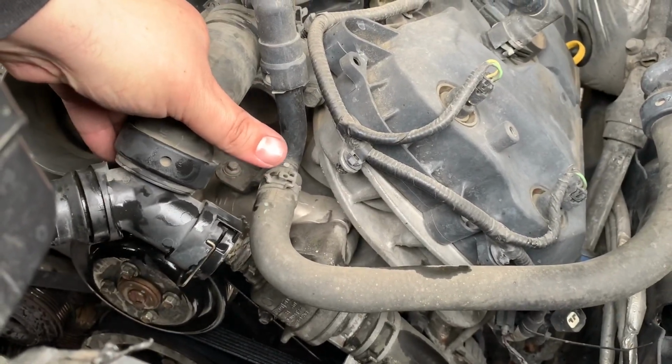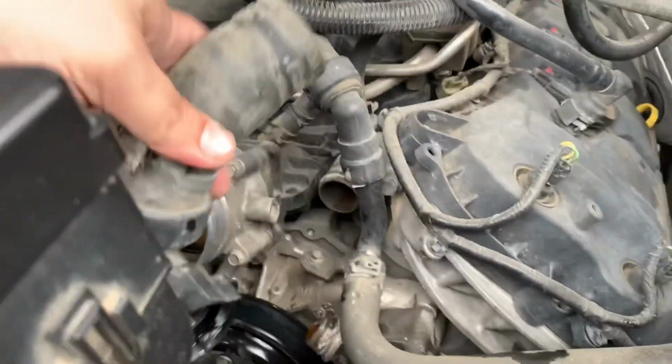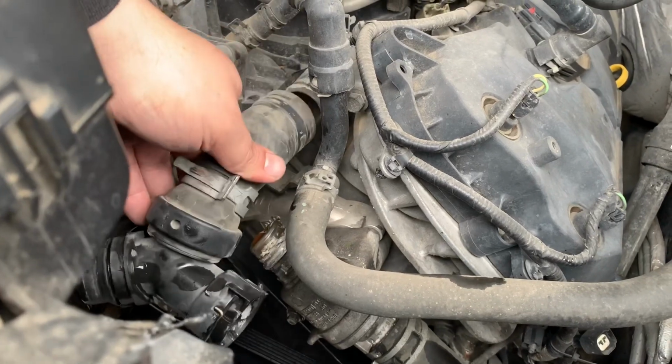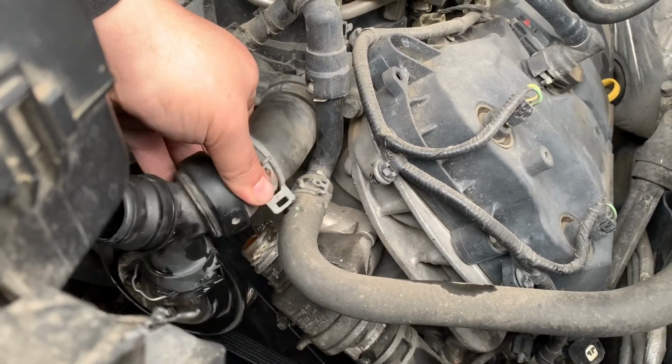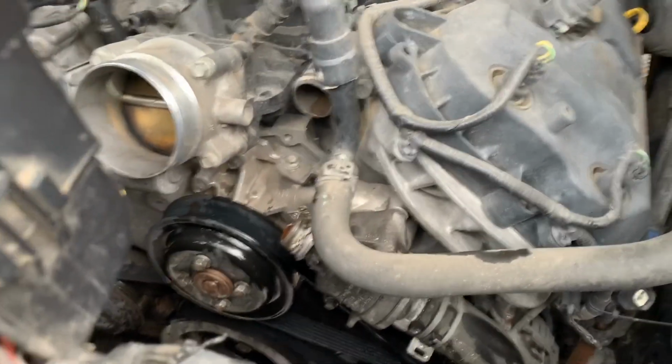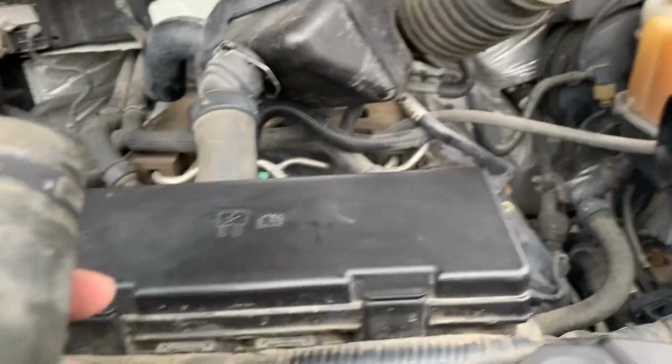And the trick was, this guy was up in there like that. Well, I pulled the upper radiator hose off first, get that guy out of the way, let it drain a bit. Then I got the leaky side, this side out, and then what I did was I just twisted the whole thing to break this seal loose and pop it out. And Bob's your uncle. Now I'm just gonna stab the new guy in. I'm gonna clean this up though. It's got a lot of crap on there, corrosion and stuff. So, we'll stab it back together and chop her off.